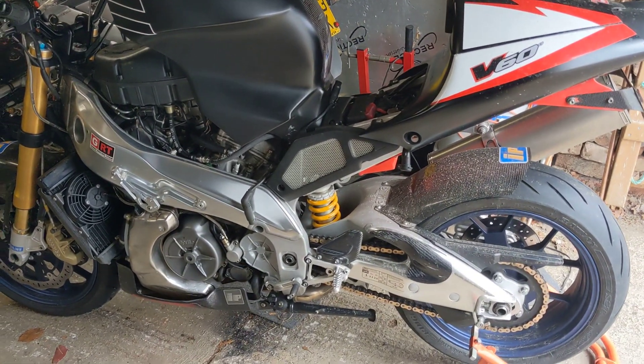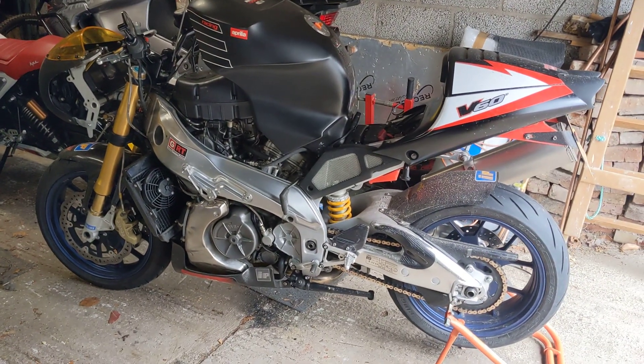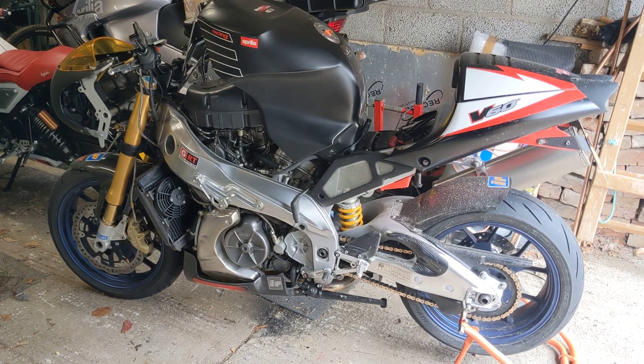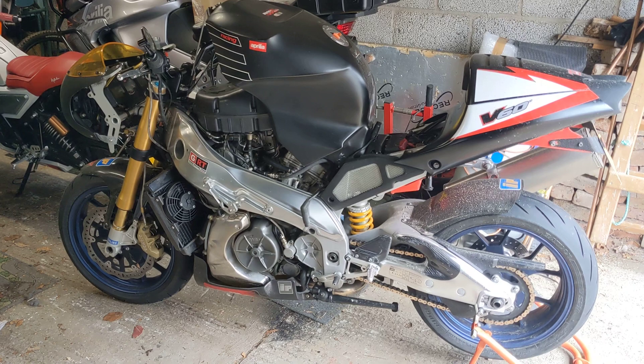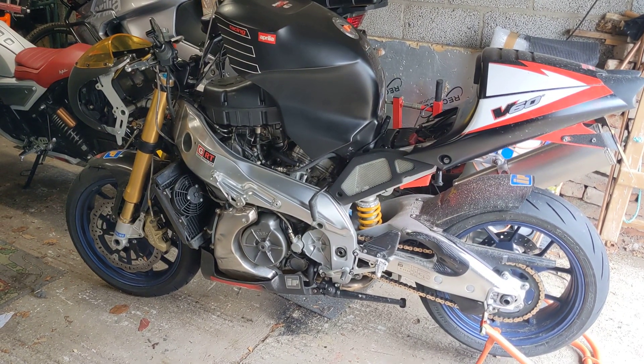This is my project bike — the one I got accused of having a smelly Italian. I put the borescope down and looked into the inlets to make sure I didn't have a dribbling injector, then had a look on top of the piston and could see dampness there as well as a bit of carbon.